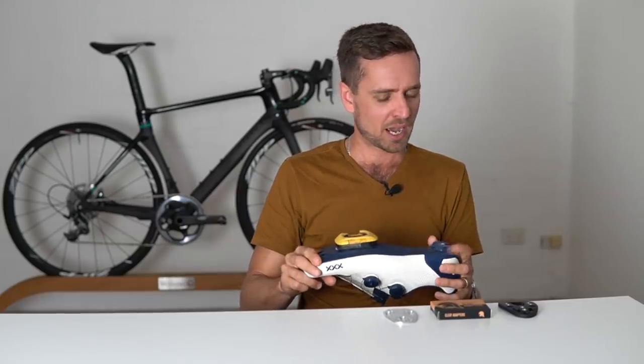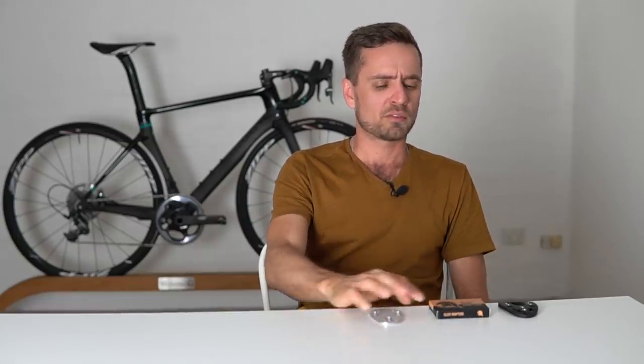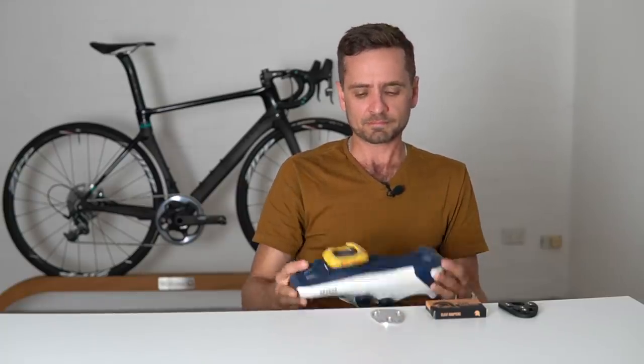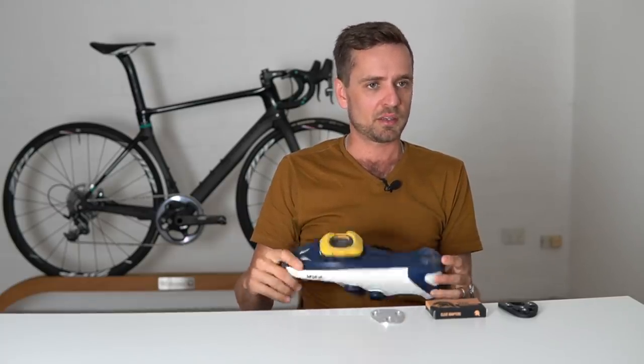So that's midfoot in a nutshell. It's a bit of a weird one, but it shouldn't be as weird as it is — it should be more common. People should recognize that this is a possible thing you can do. Even if you're just using off-the-shelf stuff and you don't want to go drilling holes in your shoes, using a Speed Play extended plate or something like the Patrick cleats here to get the cleat a long way further back can do some pretty cool things. If you had another bike that was your endurance bike and another set of shoes, you could quite easily have two positions. And depending on how much you drop your heels — I dropped my heels a lot so my seat height stayed mostly the same — but if you're a decent toe pointer, you'll need the seat significantly lower and thus the bars lower. It's a nifty little trick and it can have some serious benefits.